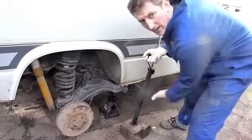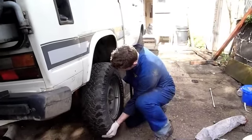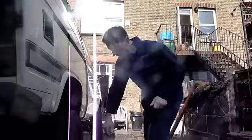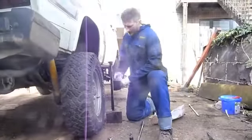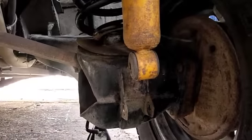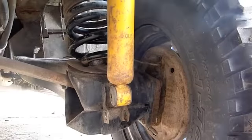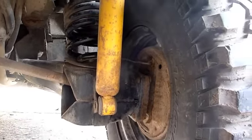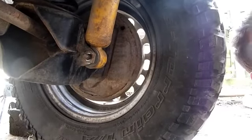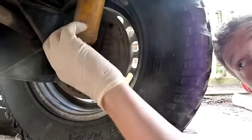I'm going to jack back up with the van so we can put the wheel back on. The wheel's back on now — bolt it up. Just going to lower down onto it, and you'll see as I start to lower, the weight of the van and the wheel lifts the arm up into place. There we go — we're in place. Nut on, turn it up nice and tight, and that's it. Job done once we've loaded the van.